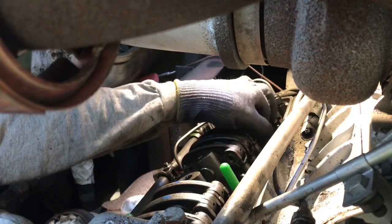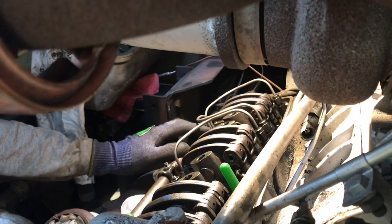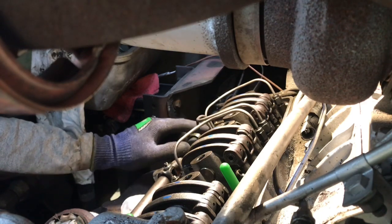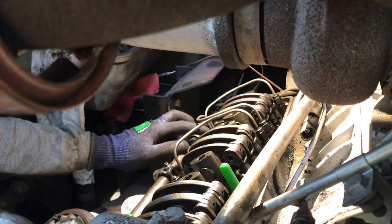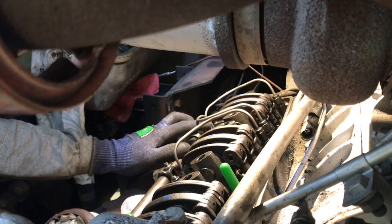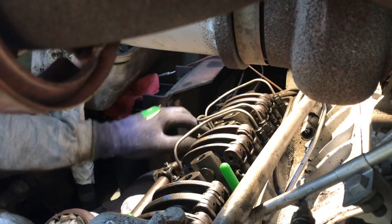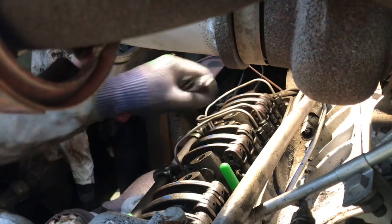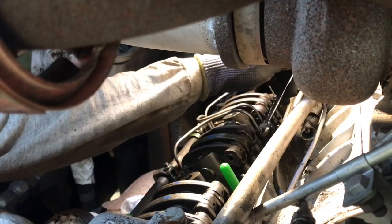These are the Jake fuel line jumpers. I've already done this side. It was kind of hard to see over here and hard to work, so I'll video the other side. But I've already set up the new Jake valve bridges, and those are put in, and I set them and checked them with a 15 thousandths feeler gauge and made sure that they were correct.